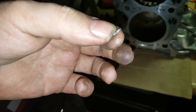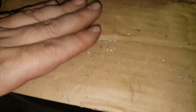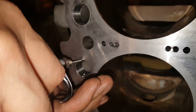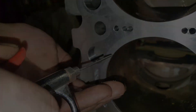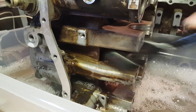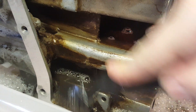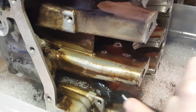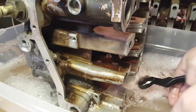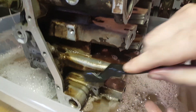We got our block back from the machine shop and it is covered in chips inside — all inside of it is just covered in chips. I'm trying to keep a clean workshop over here and it's just falling out of it. We're just getting ready to do the final assembly on this block, so before we do that we're taking a fine tooth comb and going over every little last passage and the whole underside — everything — we want to get it as clean as we possibly can. Using some warm soapy water so we know there are no metal filings anywhere.